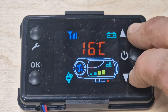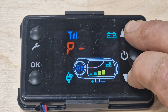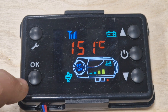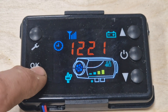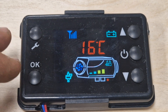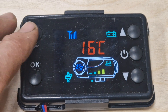Pressing up takes you back to power mode. Hold the two buttons again and that puts you into temperature mode. Set it to, say, 21 and press okay — it flips straight out. So you think it's gone, but cycling through: that's the current temperature, that's the time, that's your voltage, and then that's your desired temperature. There's no easy way to tell desired temperature from current temperature unless you're actively using it — it will always default back to temperature mode.